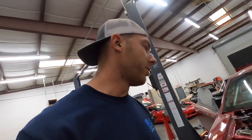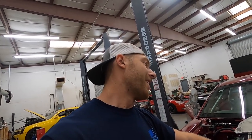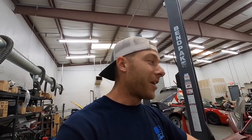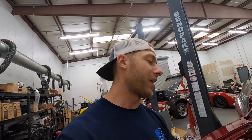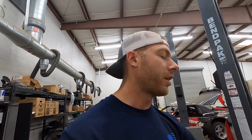This is a big update on the car — we've made a lot of moves. Still need to run the breather for the passenger-side valve cover because we need to re-weld a bung. The fuel rail clearance isn't big enough to get a dash-10 90-degree fitting, so we'll probably move it over and run a line around the intake. The car is literally ready to start if I can get my wiring in order. We leave for race week in five or six days and the crunch is on.